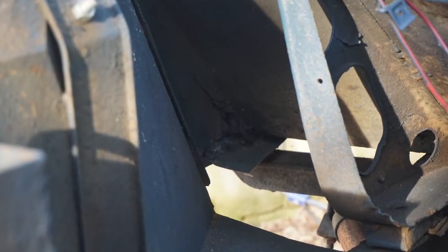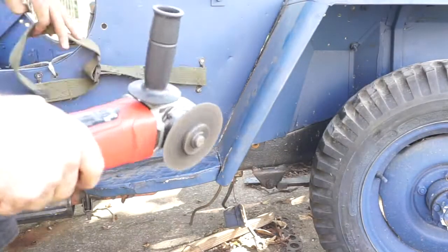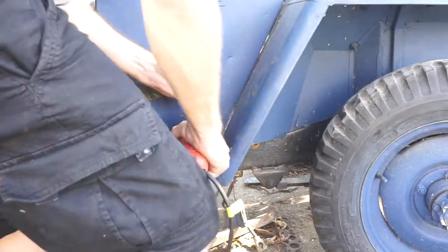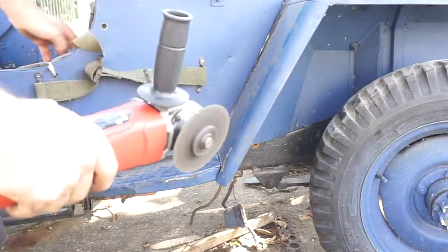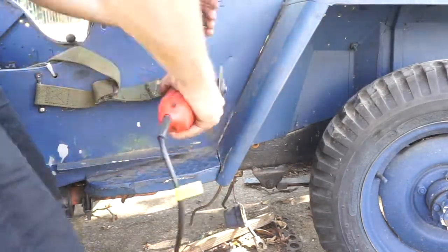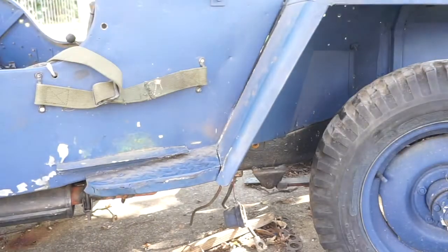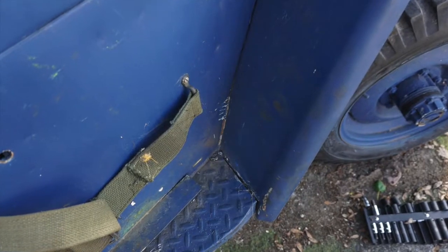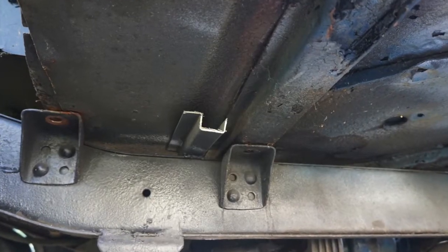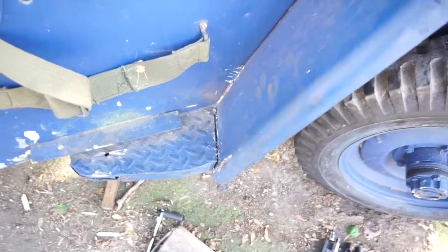There's some of that tub damage. I thought my front cowl was pretty nice and sturdy, but that front corner right there does have some rot on the inside, so I don't know if I'll just try and lay in some sheet metal and try some MIG welding on it, or maybe even brazing it in — but that doesn't seem kosher. So I may just replace that section — depends once I get a better look at it and take all this paint and body filler off. There I am trying to cut the weld between the body and the fender and the diamond plate. Also, here's underneath where it was welded with a generic hat channel thing. I end up just cutting the hat channel instead of trying to mess with the frame — I'm trying to avoid grinding on the frame until I can get a better angle on it.